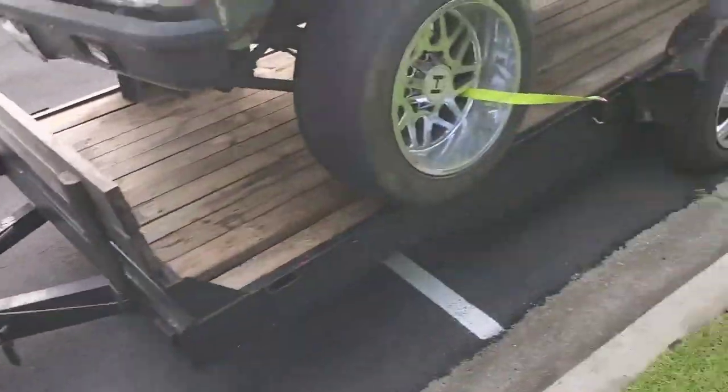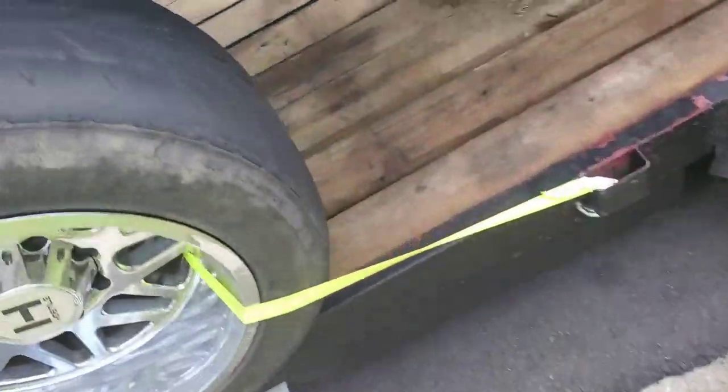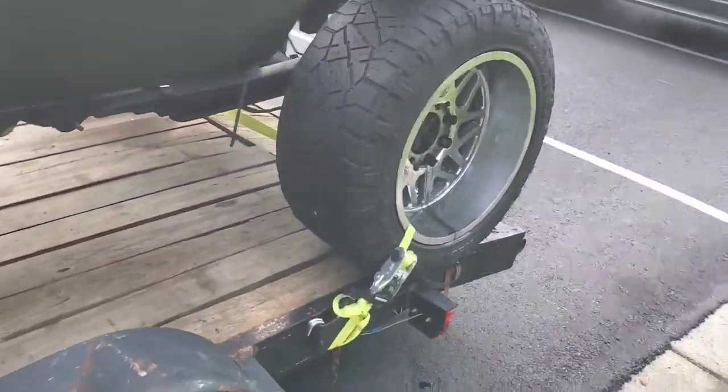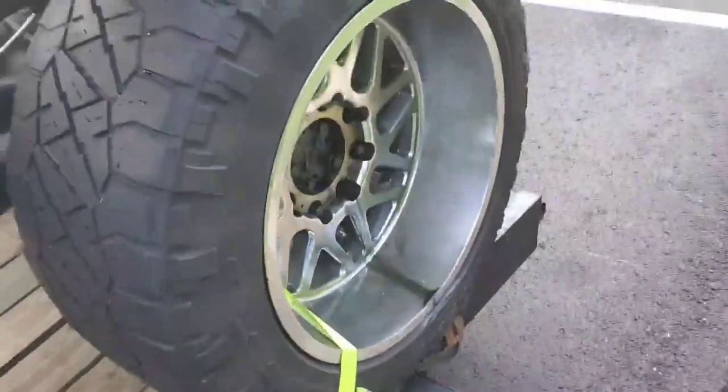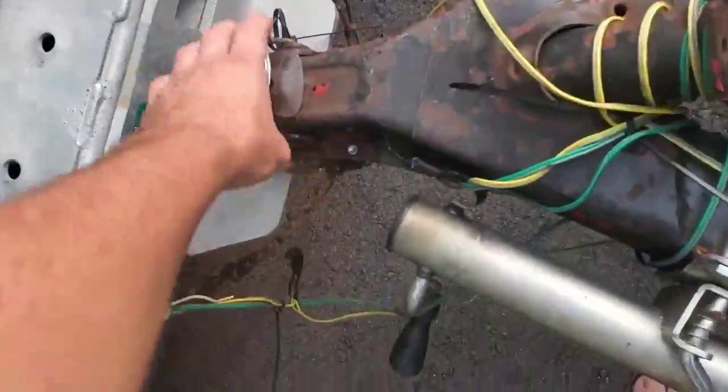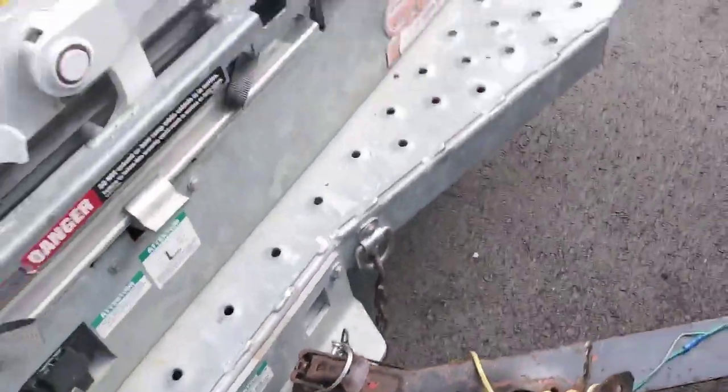We are on day three now — wow, this is getting horrible. I ended up spending the night at a hotel because it's a 5,000-pound rated trailer and I know the truck weighs 7,200 pounds, so it's a little bit overloaded. That being said, we're not going fast with it. It's the morning, we're fixing to get going. Gonna start by doing a loose pre-trip — just simple stuff: make sure the straps are still tight, air in the tires, all the chains are still here, and the pin's in place. Everything's hooked up. Let's go.